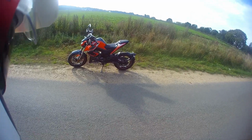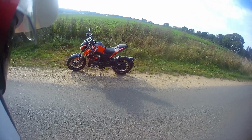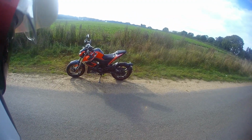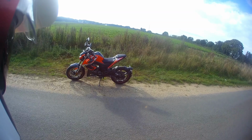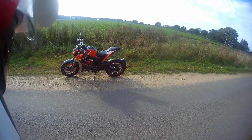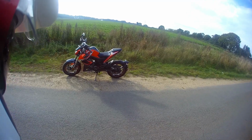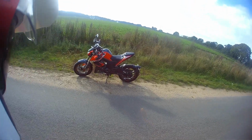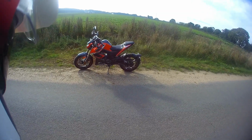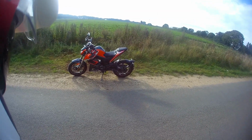So on the front sprocket, it weren't too bad. Had to take off, obviously, the nuts. So you had to smack flat the tab washer, which I didn't realise the sprocket didn't come with a new one. I've seen some of the kits on AliExpress which did, so I've had to reuse the original tab washer. It ain't too bad, it's alright, it's on there.